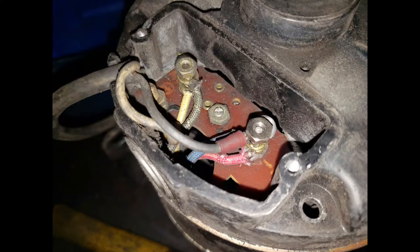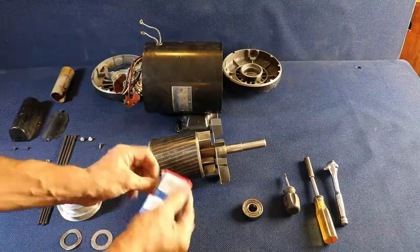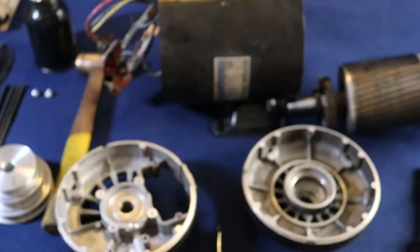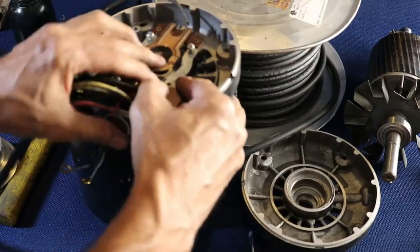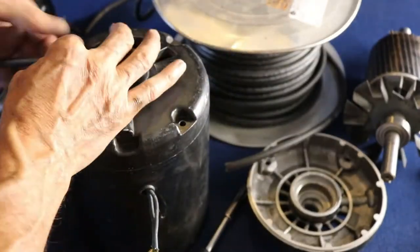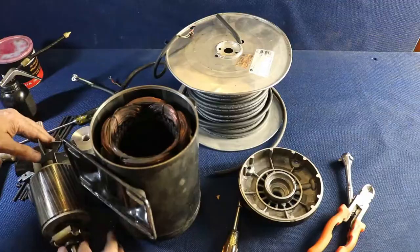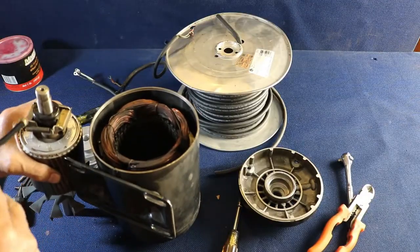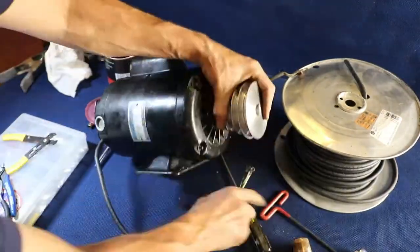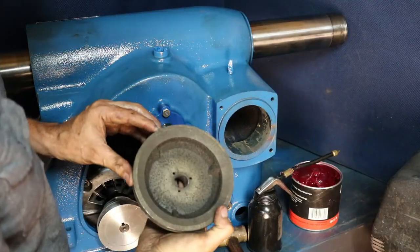The wires were also fried and brittle. So after cleaning all the motor parts, I proceeded to put it together — not before I made a new power cord with new connectors. Installing the bearing in the back plate and wiring the power cord to the centrifugal switch, then attaching it to the back plate, indexing it and snapping it into the armature housing. Covering it with the plate, then the capacitor and cover. Lubricating the centrifugal snapper and placing the armature to its casing. After installing the spring washer, the motor was assembled and ready to go. A little testing before mounting it to the mainframe — forgot to clean the pulley though.